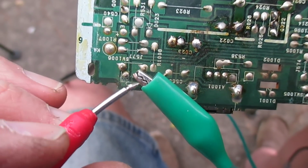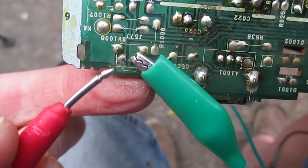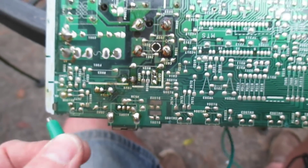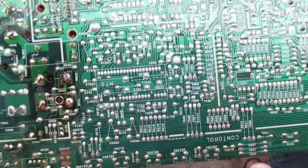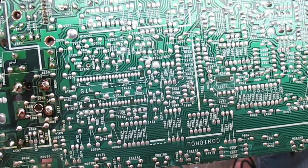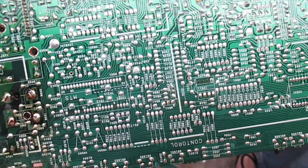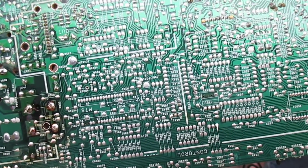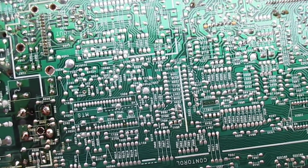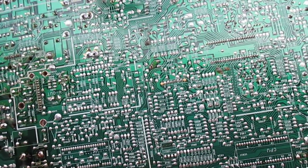It's starting to look like this power switch might be bad. I'm not getting any beep at all here, so this might actually be a simple fix. These tact switches are pretty failure-prone — after years of use they either wear out and won't make contact, or they develop internal leakage. When you press channel up, the volume may go down, or the TV will turn on by itself or change channels by itself. I've seen shops condemn sets and blame a faulty microprocessor when in fact it was just a bad tact switch.